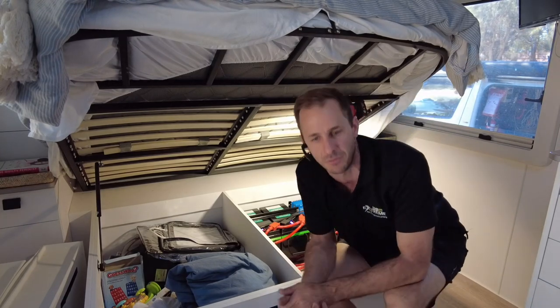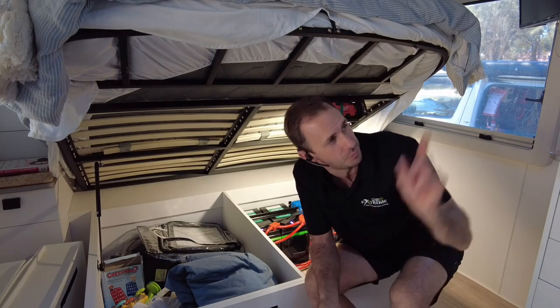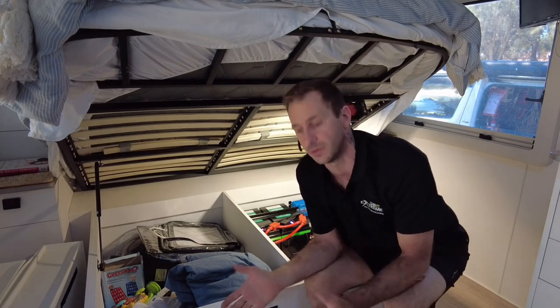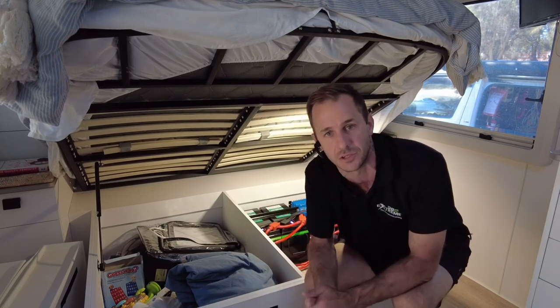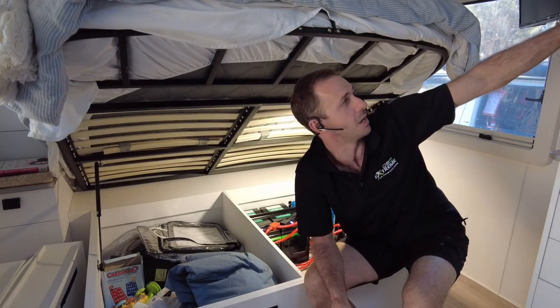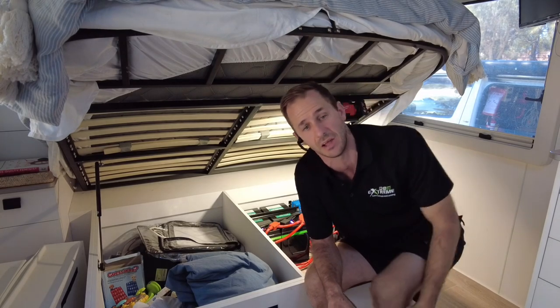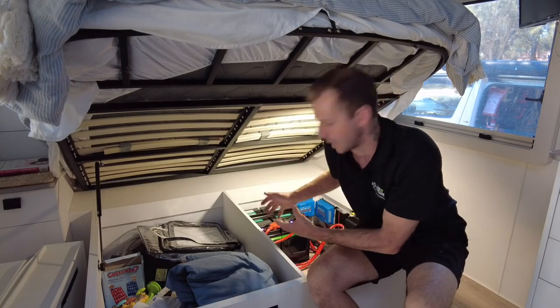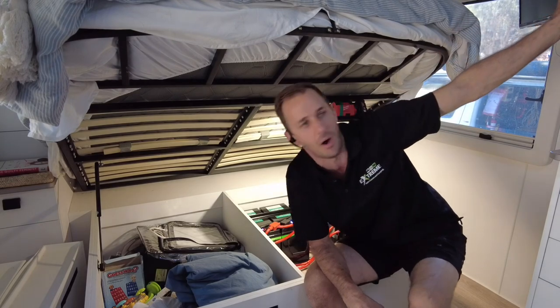And I mean everything. You turn a light on, you run a pump, you run a Sirocco fan, you put that microwave on, you put the range hood on, it doesn't matter. Every little milliamp is monitored on the Victron battery monitor that we've fitted in this. This didn't come with one. All it did was come with the RV View 2, which is what BM Pro bring out. It's a very basic monitor, basically just shows you in, out and volts. Because we've put the big inverter on this, the monstrous solar chargers and the big DC charger, it would exceed the limitations of that by a lot.